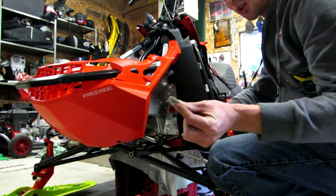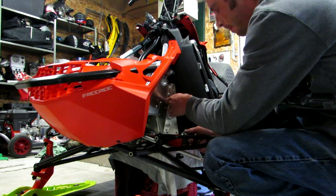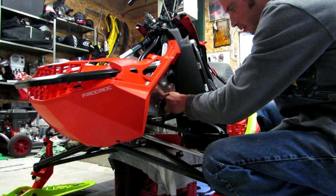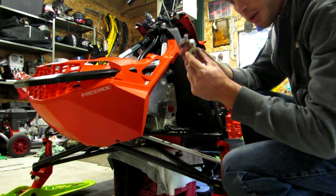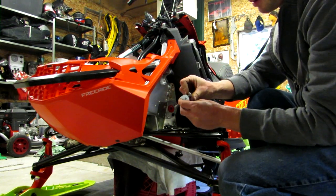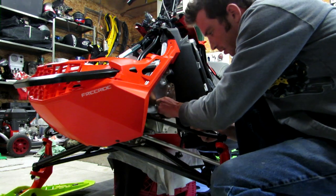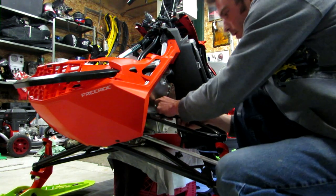Make sure to reinstall the washer behind here. Put the A-arm back in place. Remove the washer off of the bolt for the A-arm — I'm going to replace that with the Grip and Rip bracket, just like that. Slide this into the A-arm. Don't forget about the washer that we removed before that's behind.